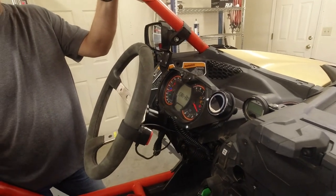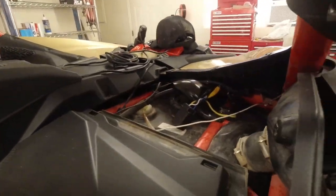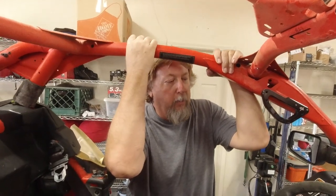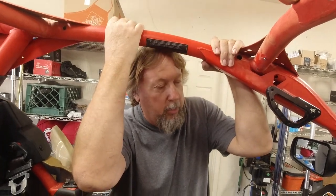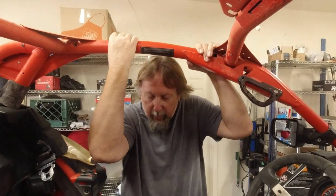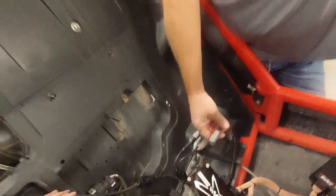Oh wow, I don't hear the fuel pump. That's not ideal. Okay, so there is something going on with the fuel pump. There was an aftermarket fuel pump relay — an 080 fuel pump in there — had to run the ground relay that the EVO requires, and everybody else requires for that big fuel pump. I don't know if I need to take that relay out. I've got a failure message up here — communication failure.